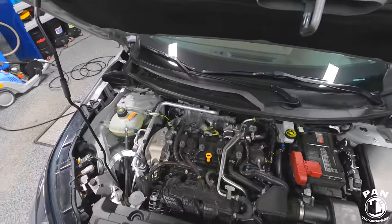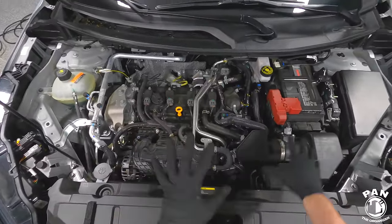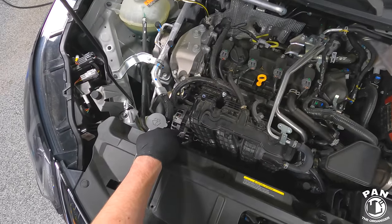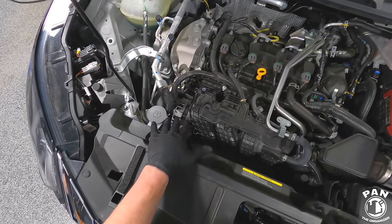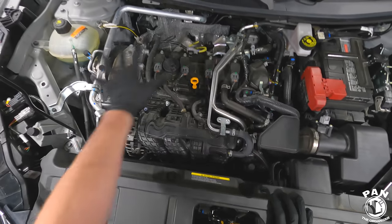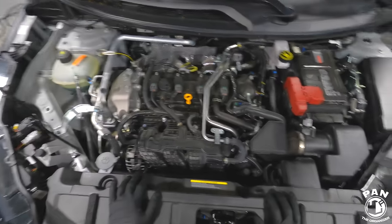You can use a regular garden hose if you want as well. As far as the sensitivity of different electronic bits and pieces, there's the alternator that you might want to cover with a plastic baggie if it's exposed like this one, but the majority of vehicles today have a lot of plastic cladding underneath the hood so you don't need to take too much precaution.